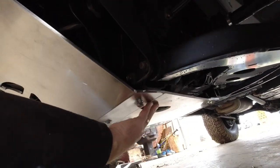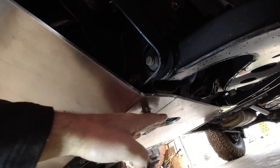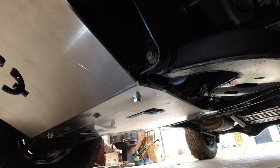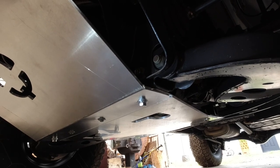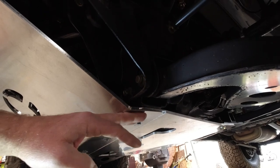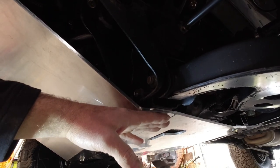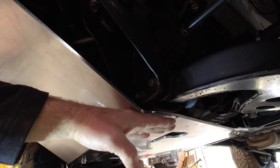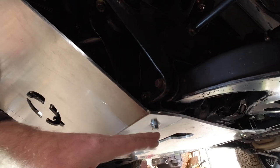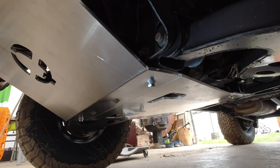I'm not sure I'd call it a full basher plate, but I think it will do. Next I'm going to look into milling some washers — about a quarter inch thick — that will allow things to skid over. They're also sold by AGM (All German Motors) for about five bucks. I noticed the milling and sandwiching of the two panels made this area a bit too thin and it bent out, so for future reference I might just keep it at full quarter inch and only take the edge off.